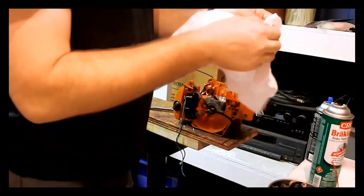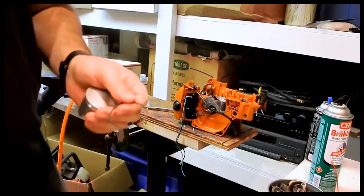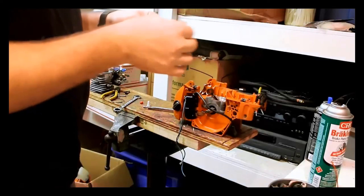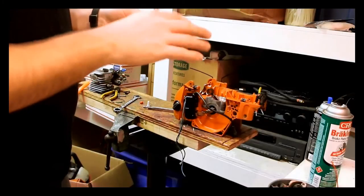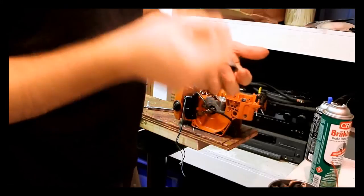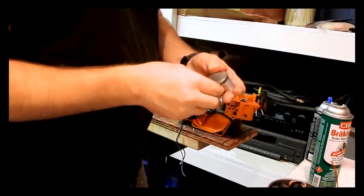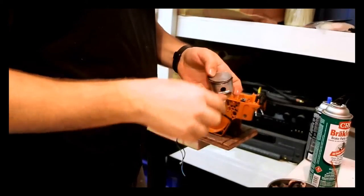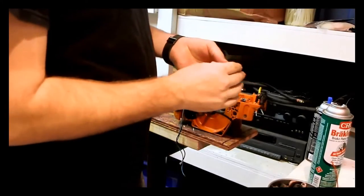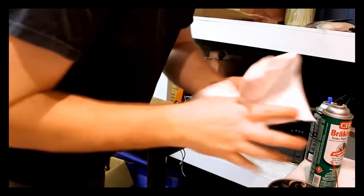Ring here. We're going to put some two-cycle oil on it. I've used grease, I've used two-cycle, used three-in-one — but it makes more sense to use two-cycle oil because that's what's going to lube everything anyway. So the ring goes in with this part down, and there's a pin here. Basically if you're doing this, it's pretty obvious how this goes in. Some of them are actually stiffer than others, but that slips on over with a little bit of lube, a little bit of two-cycle over the whole thing. Circlips.